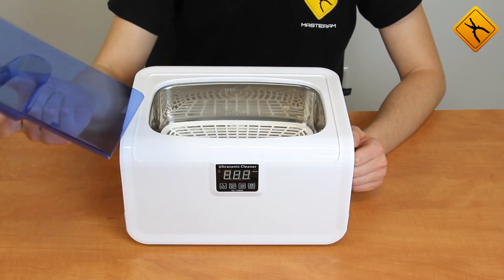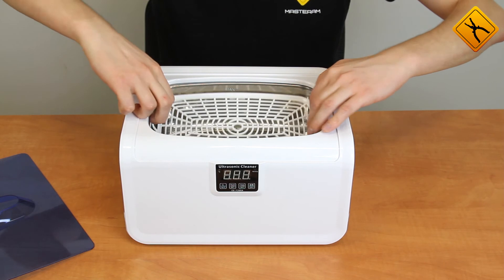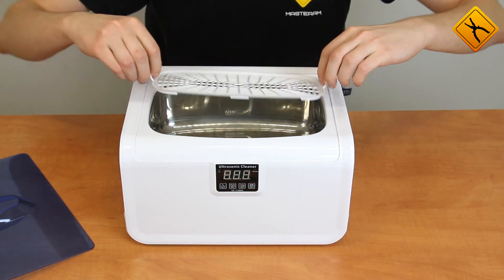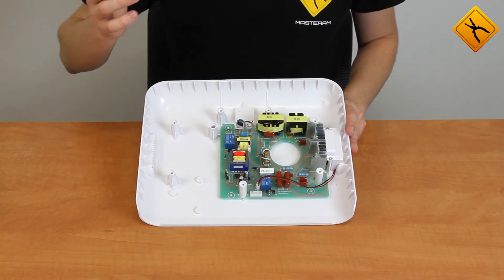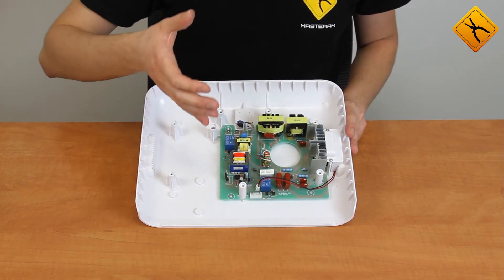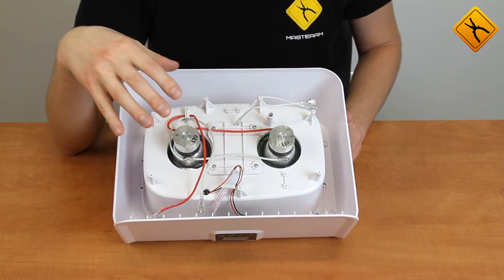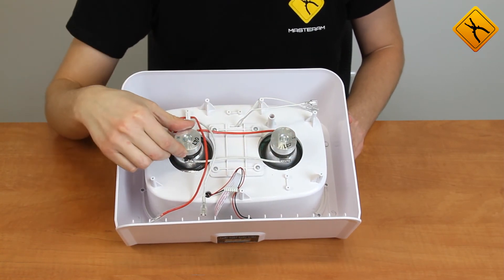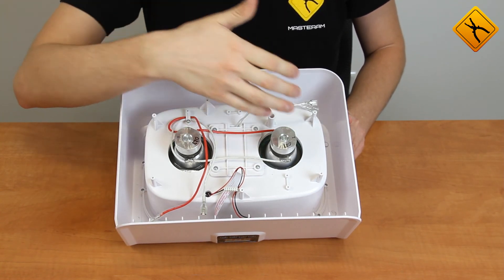It may be covered with a plastic cover to decrease noise. There is a special holder for placing objects on the bottom of the cleaner. Tank material is stainless steel. There is a 300-watt power supply inside the cleaner unit, which powers the ultrasonic sources and the tank heating element. The transmitting unit consists of the tank itself, two ultrasonic emitters at 60 watts each — 120 watts total — and a 100-watt heating element.